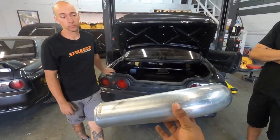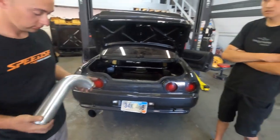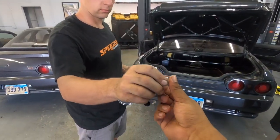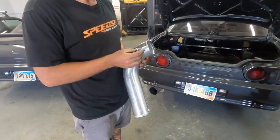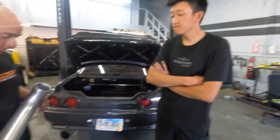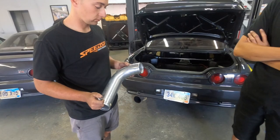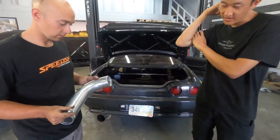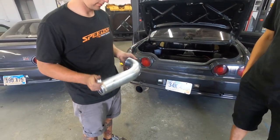So I have this intercooler piping, and I have an IAT sensor that I need to obviously be able to plug in. I have this little bung. I was wondering if you guys would be willing to just weld it in there. This is gonna be the top where the throttle body goes. Yeah, like either on the side or below, whichever. Anywhere close to the throttle body. Yeah, pretty much. Ideally, it would have been better if I did it on the throttle body that you guys modified, but I didn't have the IAT sensor or the bung at the time, so this will do. It'll work with what I got. Cool, sounds good. Okay, sweet.